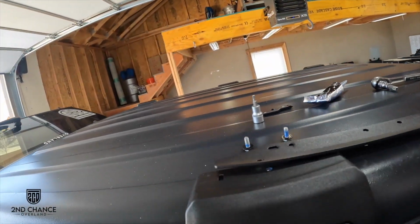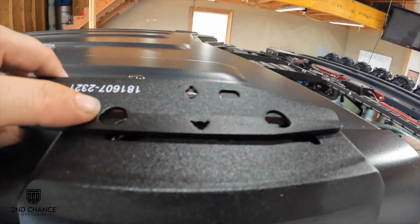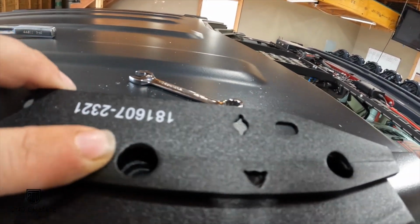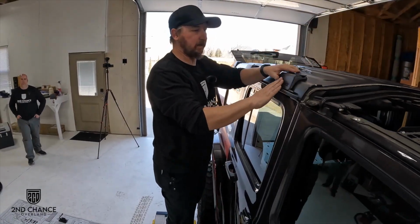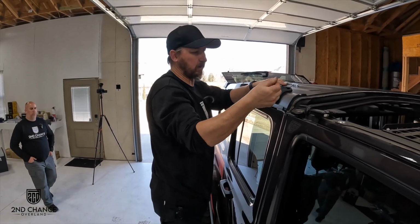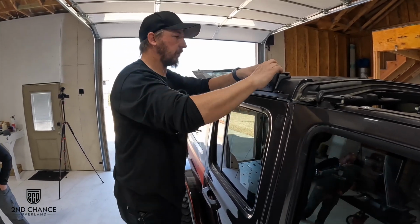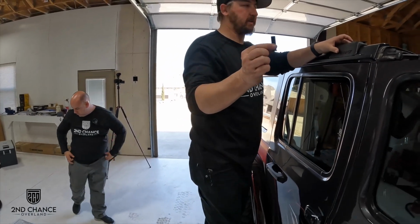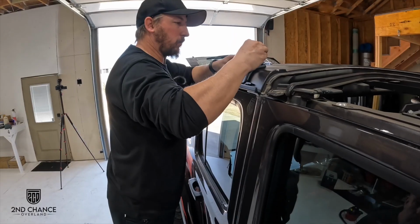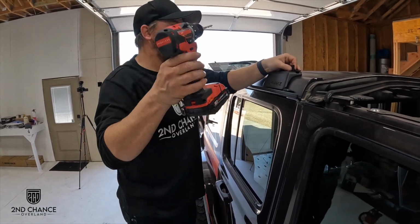Okay. So we change it up so that we use this hole here, and these two larger holes will line up with the holes that we're going to drill. So we'll bolt it in with this hole here. So we got the bracket getting our spacing. Use our special tool again on the 11 side to get our height on that. And then we need one of these that will go down in the hole, and we'll use that as our guide to drill.